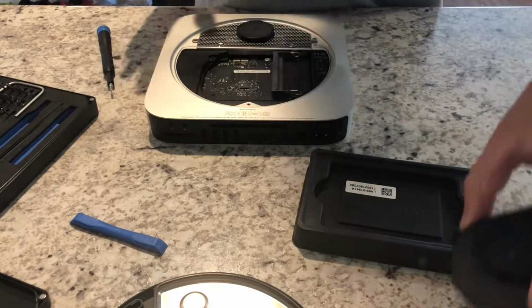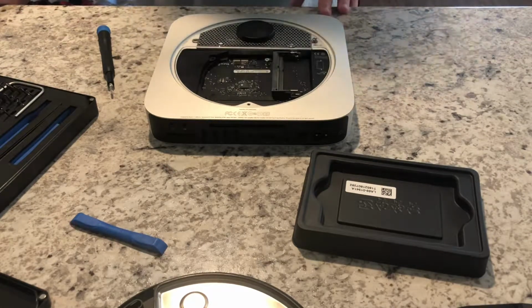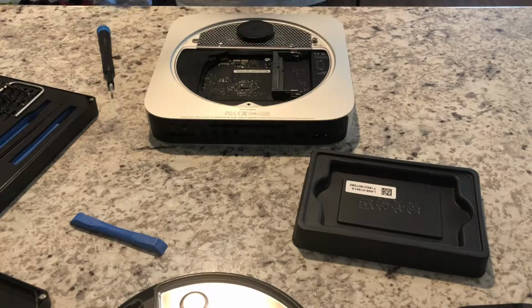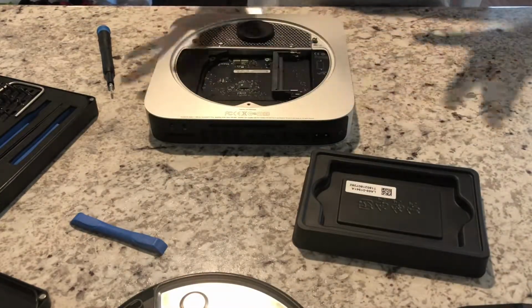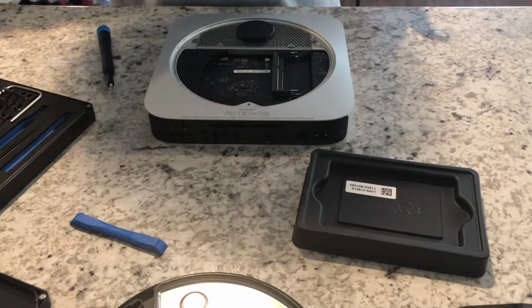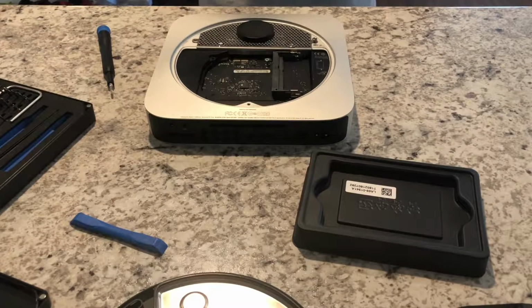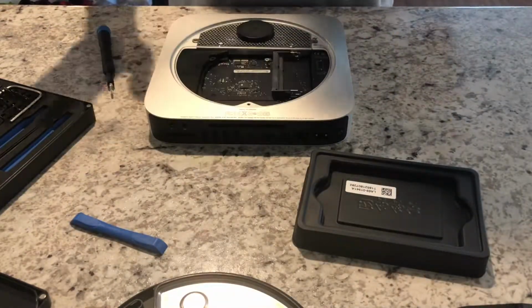I went ahead and plugged everything in, turned everything on, and then all of a sudden, within 5 minutes, my Mac is incredibly hot, to the point where the internals are probably cooking. Obviously I turned it off, unplugged it, and let it sit for a while to cool down. Come to find out, it wasn't installed completely flat. Because of that, the connector wasn't actually connected, and the fan wasn't running. So that's definitely something to keep an eye on. Make sure that you have that done.